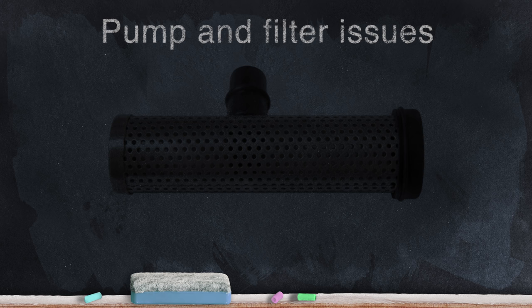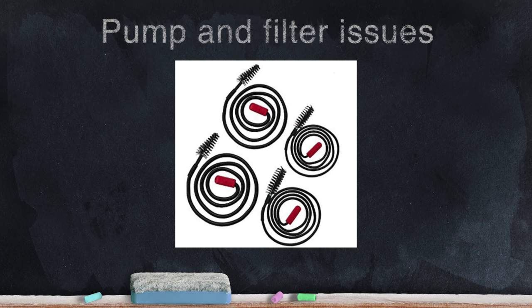Now lastly, what to do if you knock your filter off. You will find that doing this will really clog up your pipes and pump. This happened to me once and I ended up having to take the route of clearing the pipe using a long tough wooden stick. But depending on how bad it is you may need to empty the Grainfather and blow out the pipe using a hose as shown before. Unblock wires used for plumbing and such like can also be very useful here. Just make sure you turn off the pump and do not use too much force.